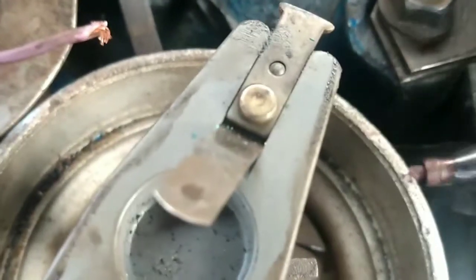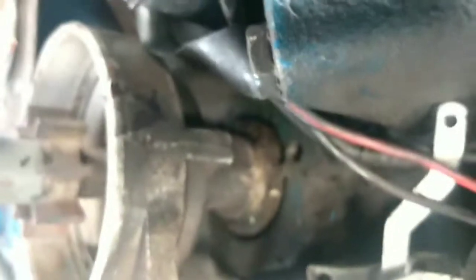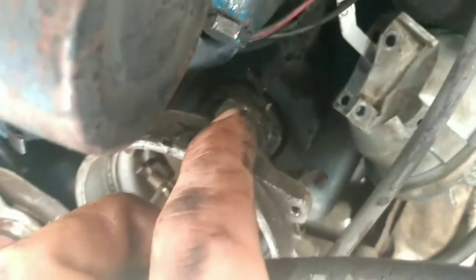Do it just like plywood. Do a V, so that your starting point is your point, because the marker made all kind of marks in between. But see, now I know where the distributor needs to be in reference to where the engine is at. That way I know where everything's at. See that beard on the side of the distributor is basically pointed at that bolt hole. Pretty easy reminder there. My goofy phone decided it wouldn't record after I hit record.